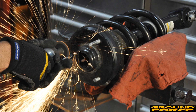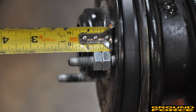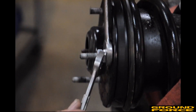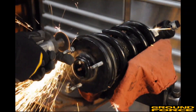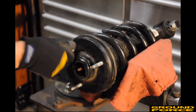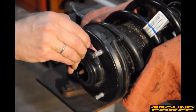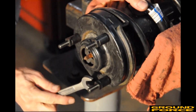For the following steps, it may be helpful to place the strut assembly in a vise. Shop towels can be used to pad the coils to prevent damage. Thread the two supplied free-running hex nuts onto one of the studs, down until they are three-quarters of an inch above the top of the strut mount. Using a wrench, lock the nuts in place. Using a cut-off tool, remove the remainder of the stud. Remove the hex nuts from the stud. Apply the included thread locking compound to the threads of the stud. Thread a strut extender onto the trimmed stud and firmly tighten to the top of the strut mount. Repeat these steps for the remaining studs.